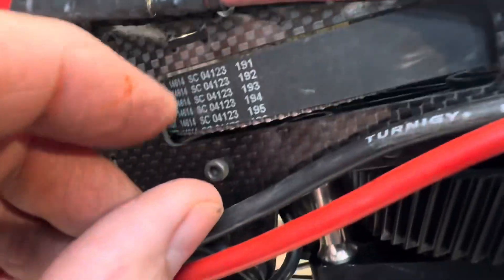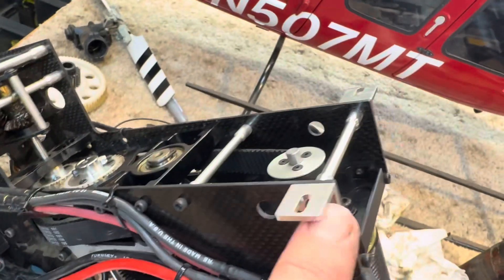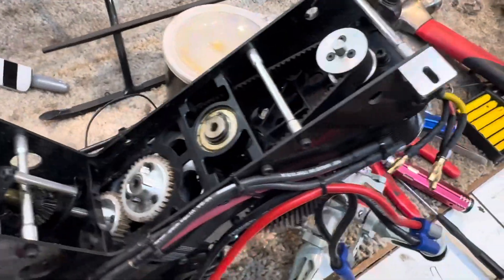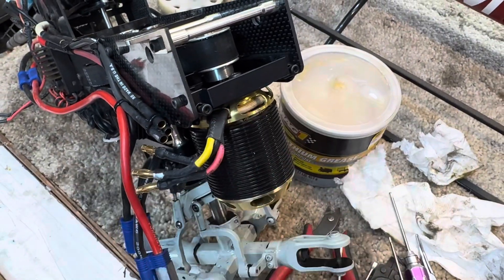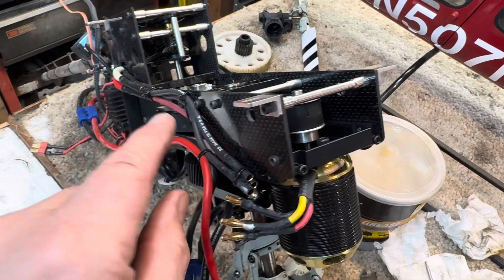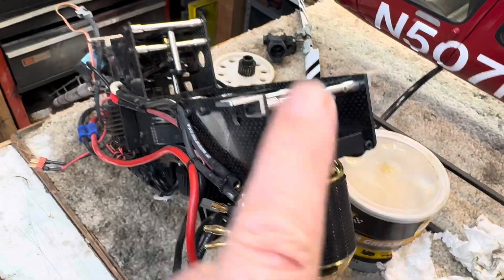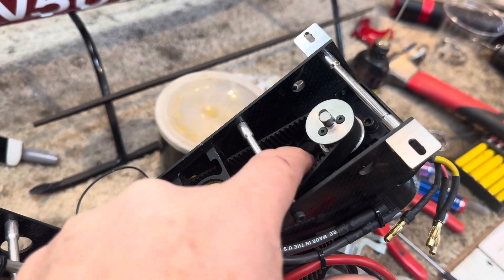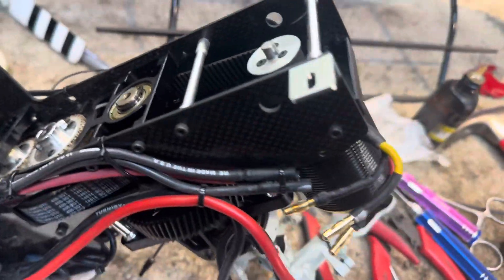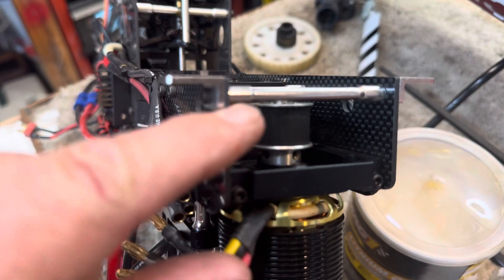You want it kind of lined up on there. I'm a little low, so I'm gonna adjust that up. Once it's kind of snug and tight, I'll spin it around and make sure that it's not rubbing on anything, and then it's at the right tension. Because right now it's super loose — I haven't tightened up these two bolts which slide the motor back and forth. So it's an adjustment game as you're tightening things up, making sure that it's not too tight, making sure that it's lined up. I kind of snugged it down, so I've got the motor bolts tight. I started adjusting for the tension, which is still a little loose. But now whenever I spin the motor, I am rubbing on here. So I know I need to take the pinion and drop it down on the shaft.